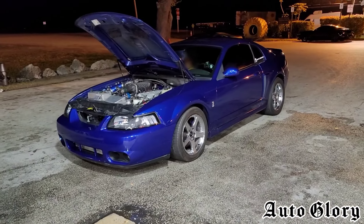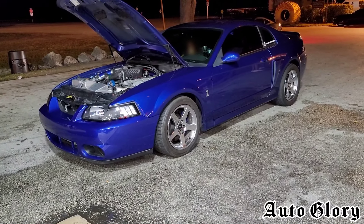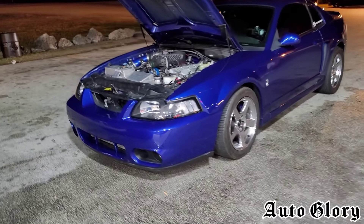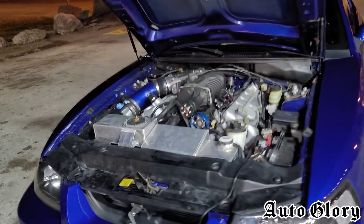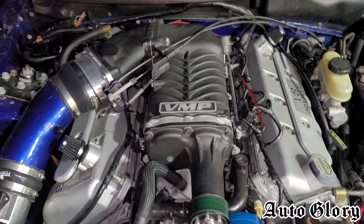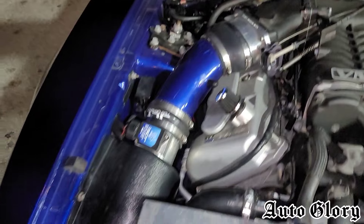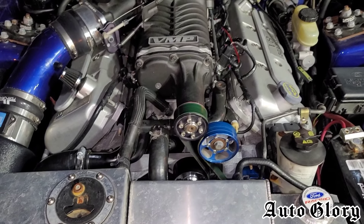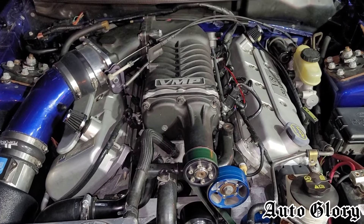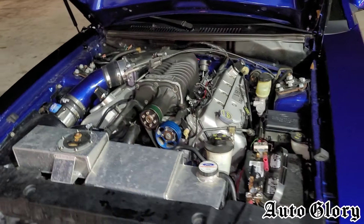He's been running up against a 2003 Ford Mustang Cobra. Now the last time we saw this car on the channel was many months ago — he's actually a little bit faster than he was in the past. He's on an upgraded 2.3 VMP supercharger with an upgraded single-blade throttle body intake, upper pulley, long-tube headers with a three-inch dump, and a custom 93 tune. The owner says he's making low 600s to the wheels.